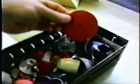Here's one that the paint is coming off already. Now, if you take 80 grit paper and make the spinner really rough, the best choice is to sandblast it, of course. Sandblasting is always choice one here. Anodizing, aluminum anodizing is the way to get paint to stick forever. You can also buy a product at the airport that they use. It's a green, a light green paint that they use to bond aluminum to paint. I don't remember the name of the product right offhand, but it worked real well. I had a can, it was very toxic material.